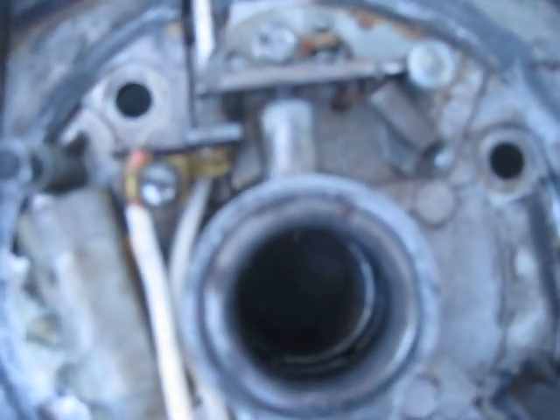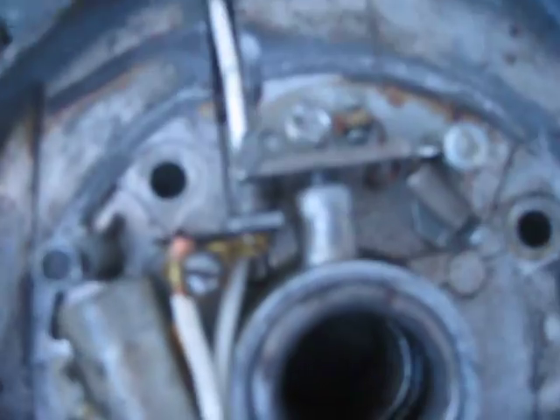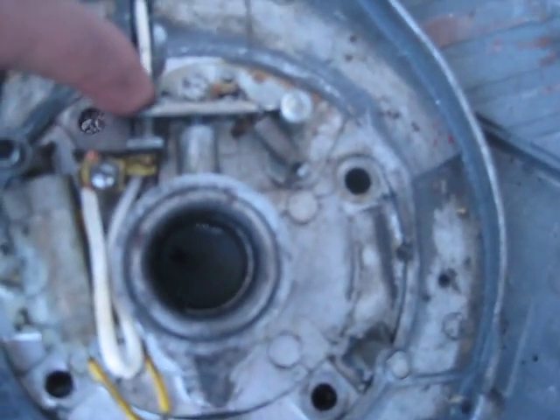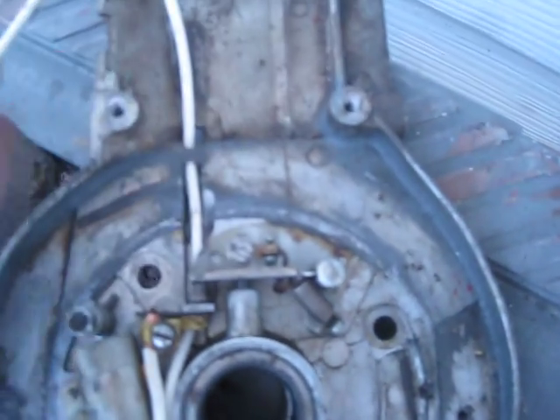You want to take a wire from this terminal and just have a long wire coming off of that. If it's on a modern engine like this, usually it's going to be all soldered together and there's going to be a wire going to your magneto. So just cut that off and solder a new wire on it.